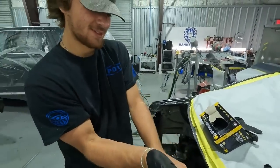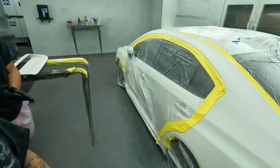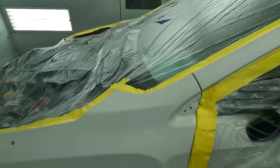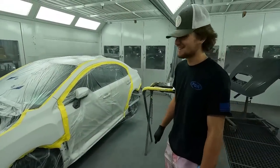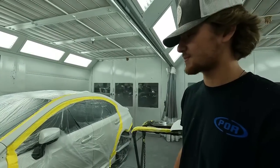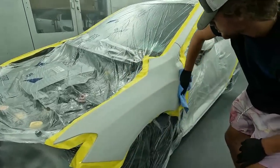First thing he's going to do is put on some gloves, because we're going to have him clean down the job in the booth. Being that this is his first day and I wasn't really aware he was starting today, I'll have a regular list of procedures tomorrow — that's what I give my guys when I train them. But today we're just going to wing it. I told him: what do you always clean first? The blends. Always clean the blend first because it's the cleanest — you don't want a dirty rag on the blend panel leaving smudges.